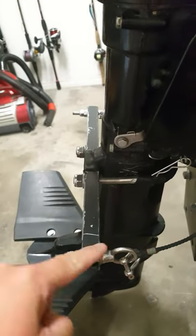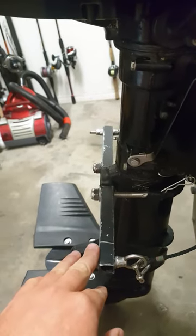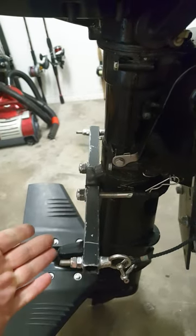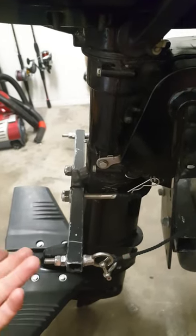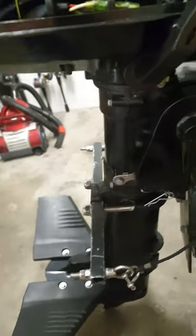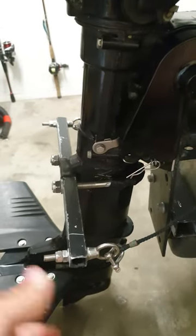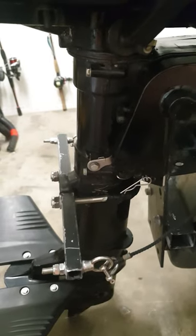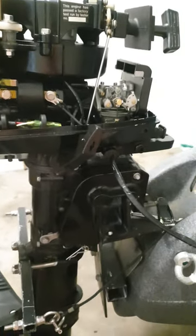When you're doing these you've got to work out your leverage — if your bar is long you're not going to have the turning capability, but it will be easier to turn. If it's shorter you can do sharp turns but you have to put a lot more effort in, which puts strain on the leads, joints, and pedals up front. I went with a decent length and I can do full lock at full speed and still be very stable.